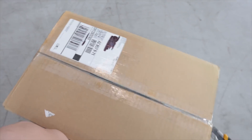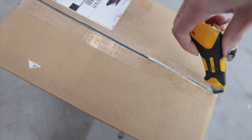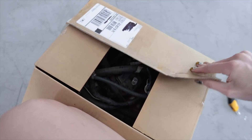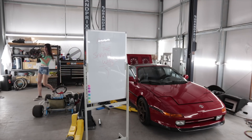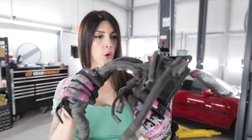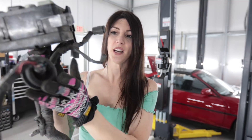I got a body harness that came in and some other stuff. Inside this box is a 91-92 MR2 Turbo Body Harness. The reason why I ordered this, if you don't remember from the last video, is because mine has creepy green death. It's 30 years old, just like mine is. It's dirty, but there's absolutely no creepy green death. It's got the bottom of the fuse box — mine was missing that, which is probably why mine looked like poop. It's cut right here where it goes to the engine harness, but I would have to do that anyway.